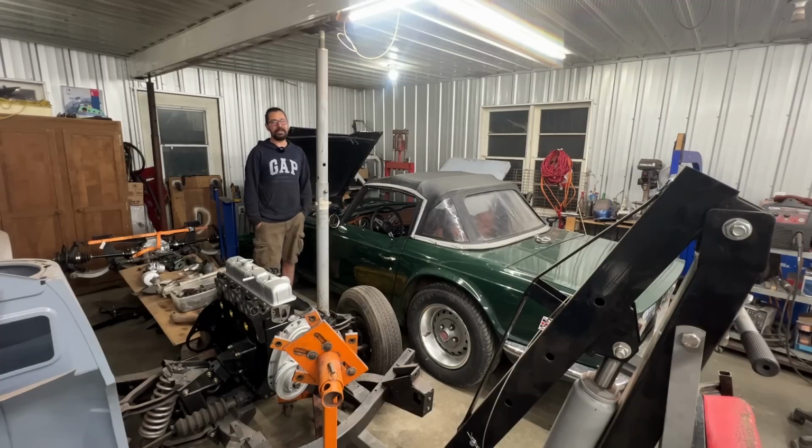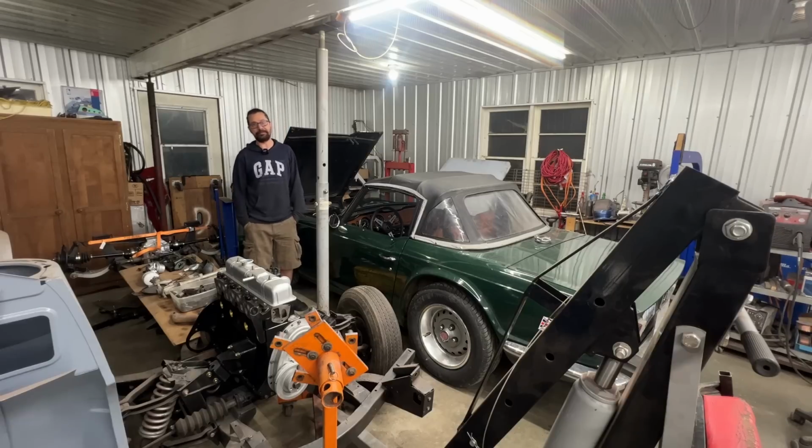We decided with David that we're not gonna do anything about the clutch for now. I mean, it drives well, it shifts well, it doesn't grind gears or anything. It's just that it engages and disengages too low. And that's fine. My Spitfire is like that too, and I drive it no problem. If it feels like it is affecting how it shifts, then we're gonna have to do something about it. But for now, we decided that's how we're gonna leave it.